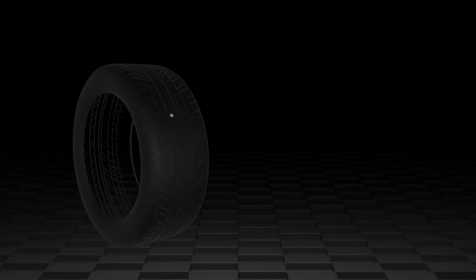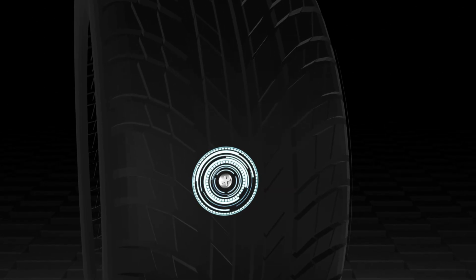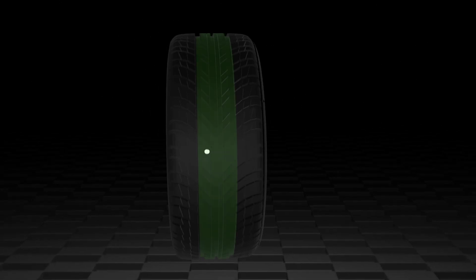branded products and tools. When you notice a foreign object in a tire that has been brought in for repair, the first thing to do is identify the injury. There are certain parts of the tire, like the crown area, that can be repaired, but there are also limitations, like the shoulders and sidewall, that are not repairable.